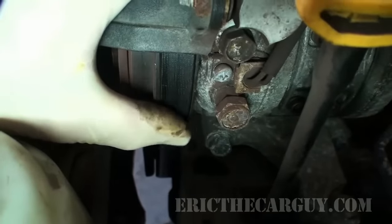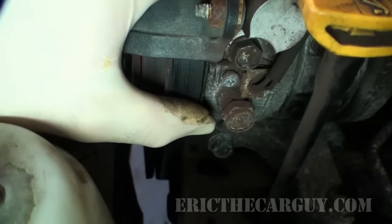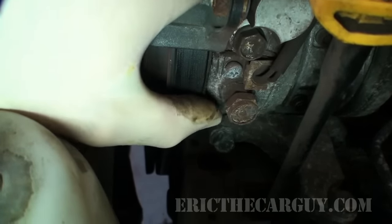Here's an area of interest when you're looking for leaks: look just behind the AC compressor clutch and pulley assembly. Sometimes the front compressor shaft seal might leak, and if it does, it will show up in this area. Well, we know my repair didn't work for sure now — I can definitely see some leaks there. I only put a small amount of refrigerant in there, and you really don't want refrigerant getting out into the atmosphere — I consider that just irresponsible.